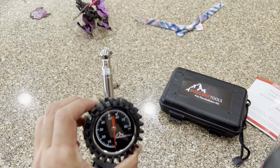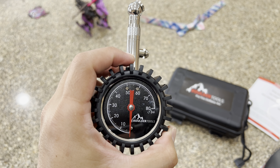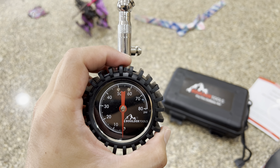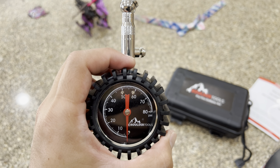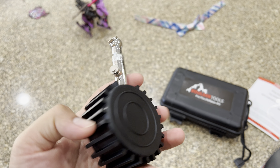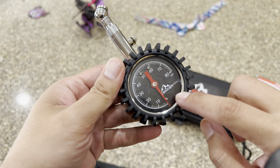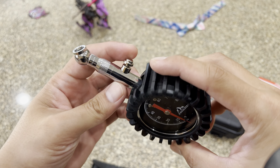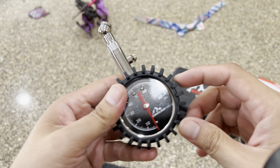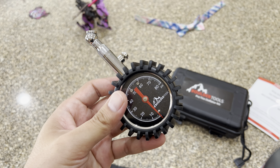Let's talk about the things I like about this kit. I really like this pressure gauge right here. It's very accurate — I have a few different testers at home and those are really good, and this one matches them. Very easy to use: just push it into the valve, you see the pressure, and when you want to reset, just hit this button. It's very solid feeling with a little rubber ring around it for protection.